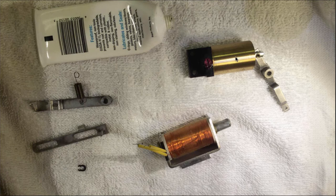What I usually do is take some silicone grease and lubricate the rod of the solenoid. I take out the plunger of the damper, clean the inside, and then put a little bit of silicone grease onto the inner wall of the damper. I clean out the holes of those arms with a Q-tip and mineral spirits, and I also put a little bit of silicone grease on the slider.